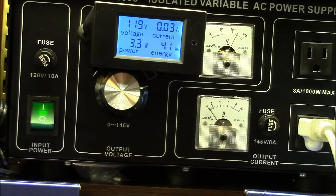If you figure 2.7 watts standby, that works out to about 24 kilowatt hours in a year just having one of these devices plugged in without even using it. When it's actually on, it's under 7 watts on low, powering both the fan and the high voltage supply — so it's rather efficient when running. Having it on standby at 2.7 watts was below what my old kill-a-watt meter would even register. Now I want to open it up and see what's inside.